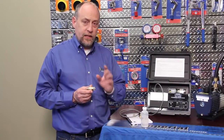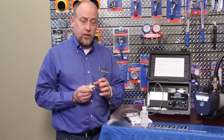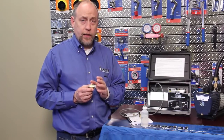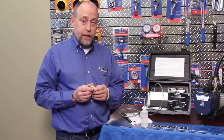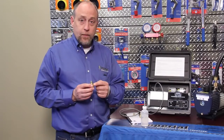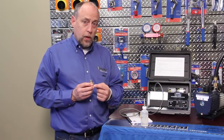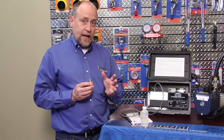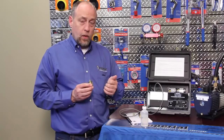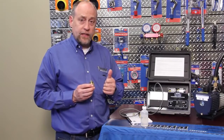The 4510 sensor is a sealed unit. It's completely soldered shut, so it's very unlikely that you'll ever get a leak in the sensing unit itself. However, they can get dirty. You do draw a vacuum on the sensor, and you can pull oil up inside the sensor and contaminate it. That's why we want to keep the sensor capped when we're not using it — to keep dirt, oil, or other things out of it that are going to affect its calibration.